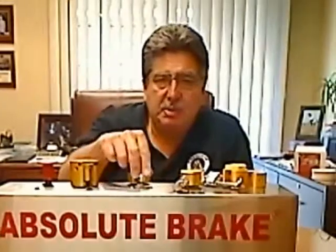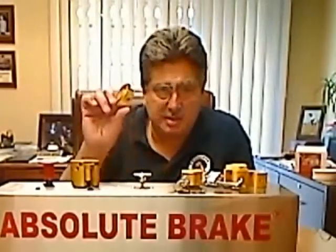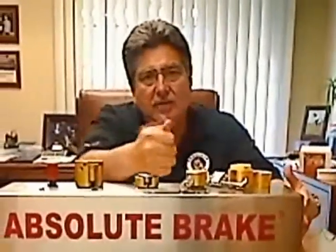The AB300 is designed for the Haldex Midland design here. This is very specific because it has a silver knob. The actual valve numbers and caps, again, are on the back of the packaging, so I'm not going to be specific about that during this video. One thing you can be sure of is that this is a very isolated type of valve for RVs and highline buses. Rarely will you ever see it on a commercial vehicle. The one thing that gives it away is that it has two pan head screws that are usually mounted flush on the surface, and this particular design does not allow for a lock, so that's why it's an AB300. Basically it swivels into place, and the vehicle is secure; it swivels off, and this is usually very tight, so you really have to swivel it on and swivel it off.